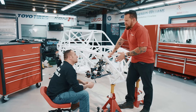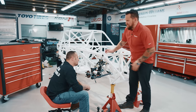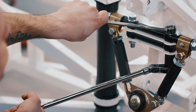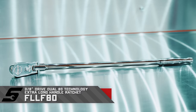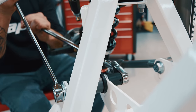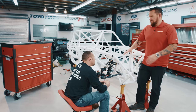Some of the other Factory 5 vehicles use donor parts from other manufacturers. What's custom and what's OEM on the corner of this chassis? Everything pretty much is made here except for the hub. Lower control arms are made by us, spindles are made by us, the upper control arms we get. Custom-made springs and Koni shocks. And what tool are you utilizing here? We're actually using a 3/8 long reach ratchet — I can actually fit it in with the control arm there. It's got great leverage; you can actually put some torque on that. When everything's put back together, we'll torque it to spec utilizing different tools.